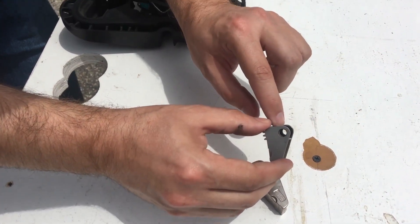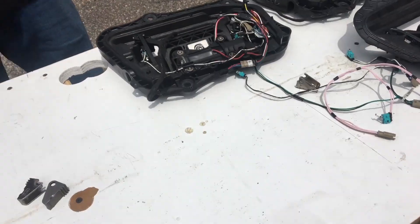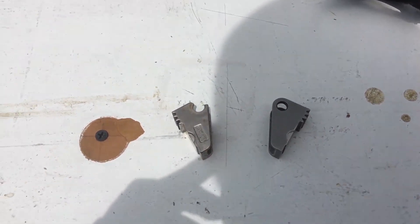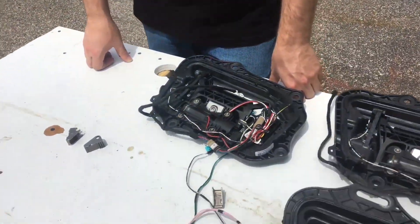There's also a set of plastic bushings on the inside to help with the load being transferred over the shaft. So if you're a Tesla owner and your car's out of warranty, what can you do? Can you send in your door handles? Yes — we do offer all of these pieces individually. You can buy the gear separately if that's the only failure point. We'd recommend doing the switches at the same time since it's almost as much work while they're already out.